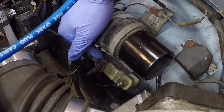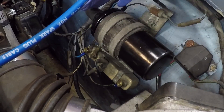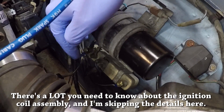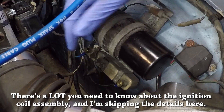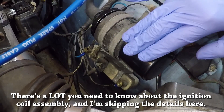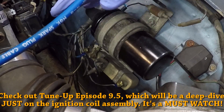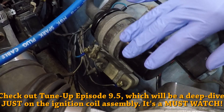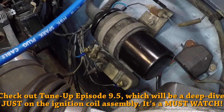The external resistor, along with the ignition coil, is referred to in the factory service manual as the ignition coil assembly. This external resistor, also called a ballast resistor, is the ceramic bar with all the connections right below the coil. It functions to tamp down the voltage fed into the ignition coil so the coil doesn't get burnt up. If you can't find this external resistor below your coil, most likely a previous owner removed it to use a non-stock ignition coil with a resistor built in — in that case, this part of the testing doesn't really apply to you.